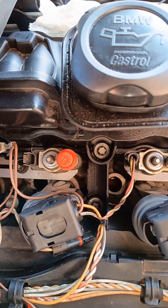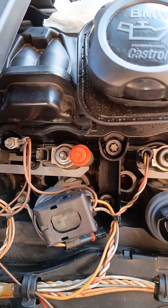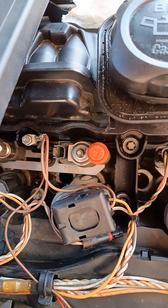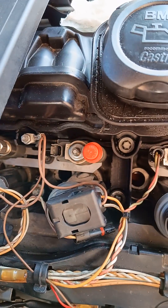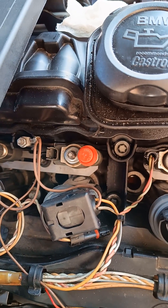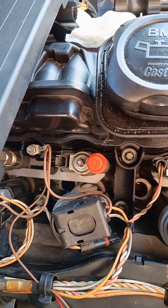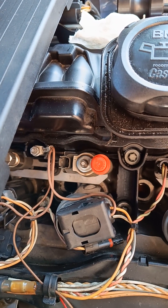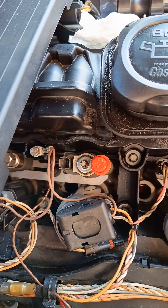Clamped it down — I think the torque is something like 13-14 newton meters, just below my torque wrench range, so I've done it hand tight. Then I'm going to screw it back together and hopefully it works. I'll do another video covering the remap, which I think can be done on Pro Tool or something similar. Thanks for watching.